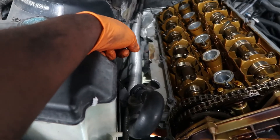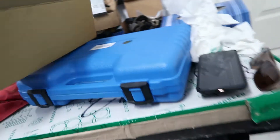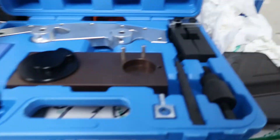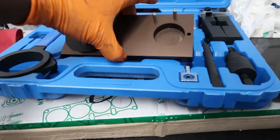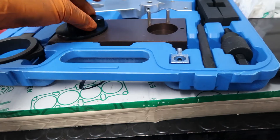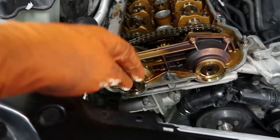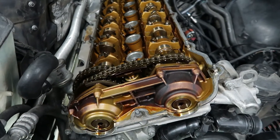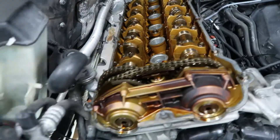He's removing the exhaust manifolds right now. I've got my brand new timing kit over here — tensioner pin, cams, all that good stuff. I'm going to deal with the VANOS now and pull these off. The bolts on the inside are left-hand thread — left-hand thread, remember that — so act accordingly.